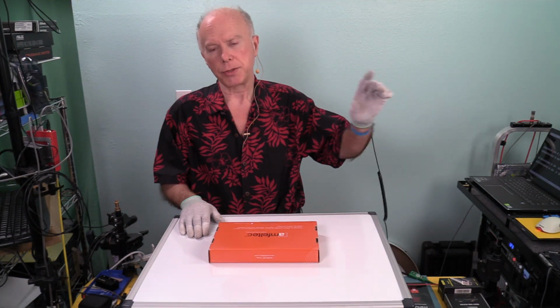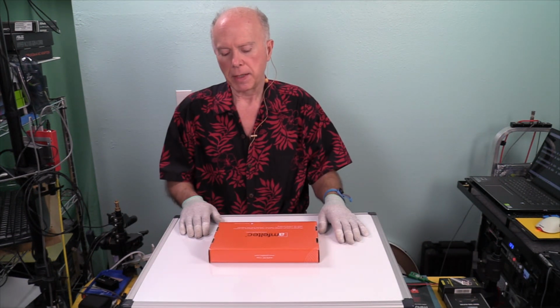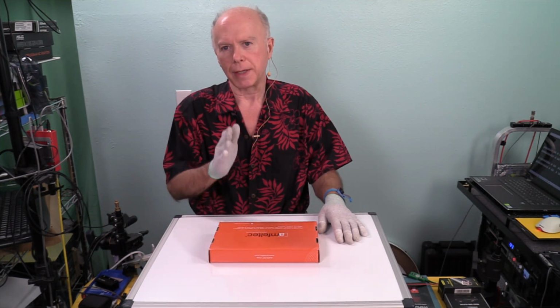And another question from another subscriber came up, and Amfeltec is the one that can deal with that, which seemed a little odd in the beginning: does anybody make a card that will work in a 4-lane slot that is self-bifurcated? Which is a pretty tall order, and at the time I said, I don't know, I'm not sure, I don't think so, but if there is, there's one manufacturer that might, and this is the manufacturer, Amfeltec.